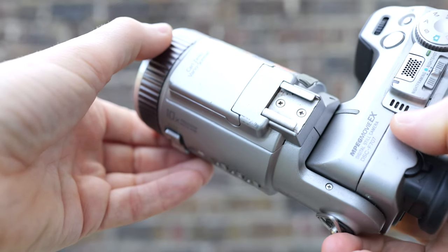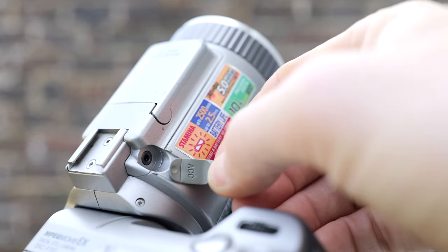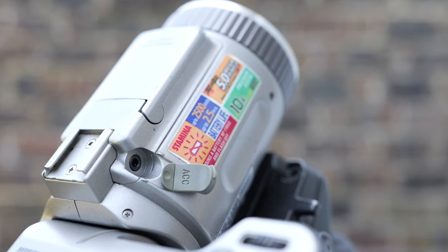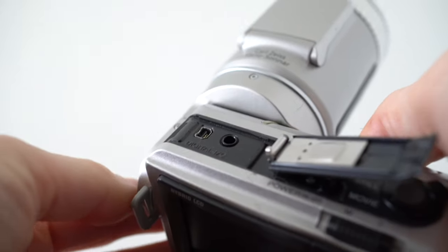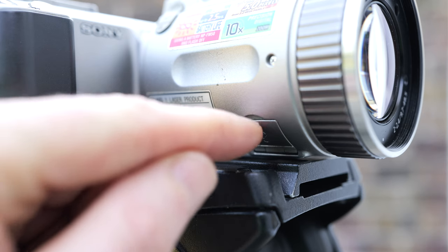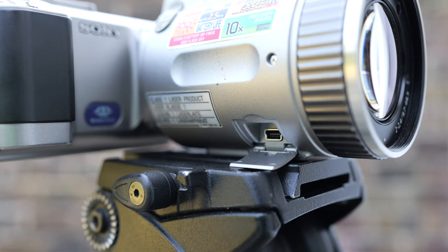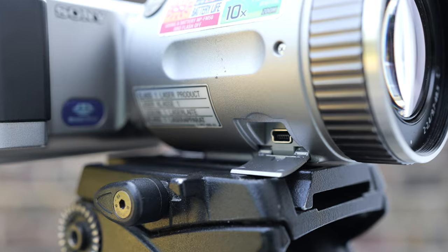Meanwhile, behind the flash unit was the addition of a cold shoe for mounting accessories, and in the absence of a sync pin, there was an accessory port alongside for triggering Sony flash guns or for connecting to remote releases. Unlike the F505's proprietary data port, hidden under an awkward and easily broken cover, the 707 now features a standard mini USB port behind a sturdier door on the barrel, allowing you to connect the camera directly to a computer and read the contents of a memory card.